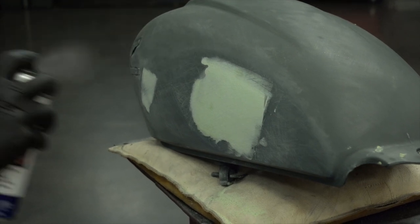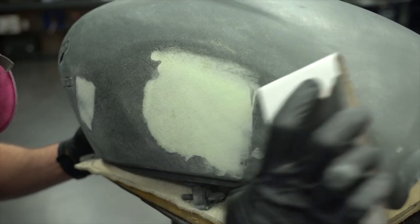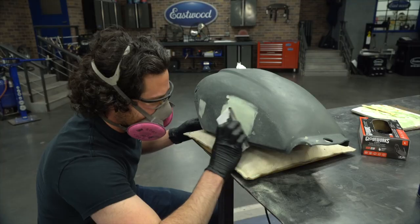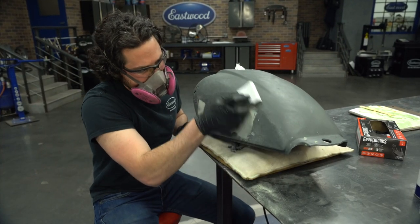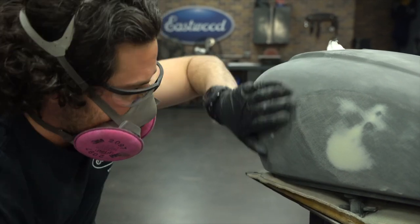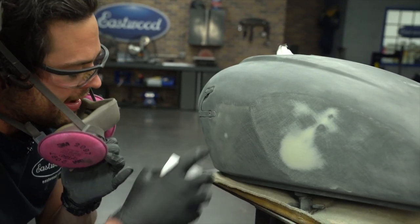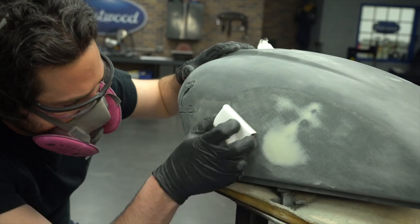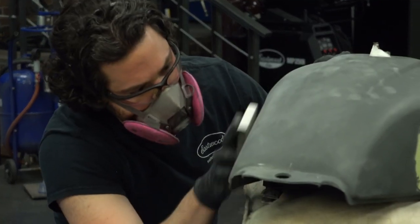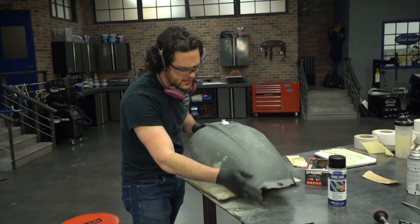One thing to keep in mind as you move through your grits of sandpaper: it's always good to have a can of guide coat nearby. You do a little dusting, then you start sanding, and you can see your sanding scratches that you left behind or your low spots. This is looking really good — pretty much just some sanding scratches here, but you can really see that little tiny low where I wanted to fill.